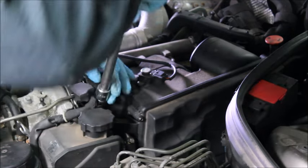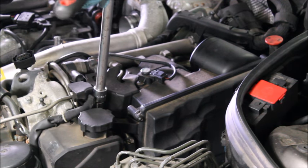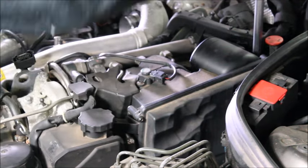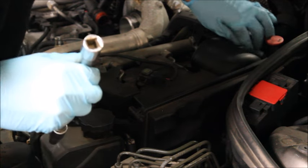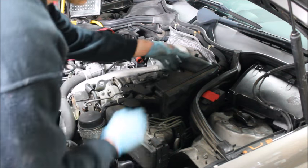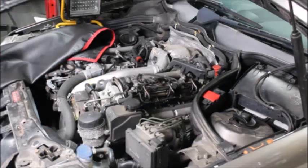You're going to need a Torx socket for this part. There are a couple of bolts to undo — the first one is near the power steering reservoir, and then another one at the back. There's also one electrical plug to disconnect. Finally, there's the triangular-shaped intake pipe to remove — this is just a push-on fitting, so you just pull them apart. It can be quite tricky, but if you take your time you'll be able to pull them apart and move it out of the way. Now you should be able to lift the air box out of the way. Underneath there's some foam cushioning material — pull that out of the way as well; it just pops into place.